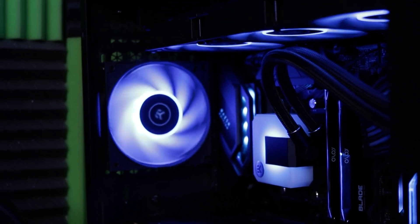There was an issue with the install involving one of the threaded pieces used to thread into the AMD backplate — it was missing its threads, which meant there was no way to install it correctly. Fortunately I had a backplate and hardware for a different EK water block that happens to work similarly and was compatible with this cooler. So I was able to use the higher-end EK water block mounting hardware, but EK, you really need to work on quality control. The AIOs may not be made in your factory, but it's worth paying attention to.